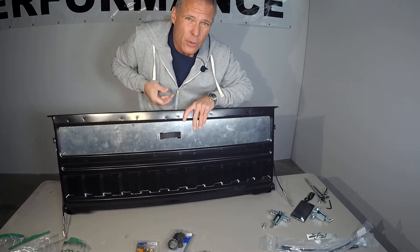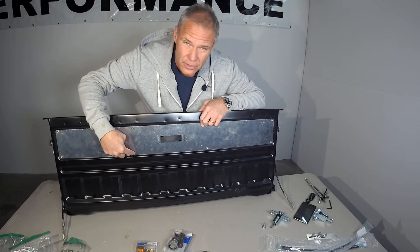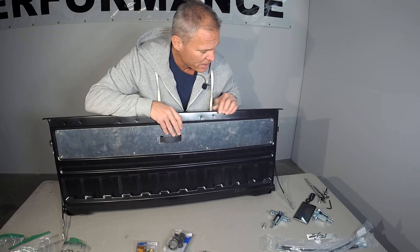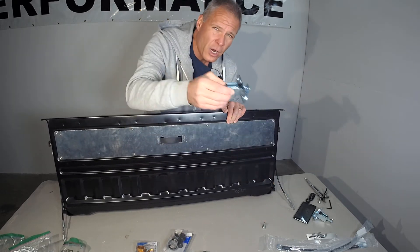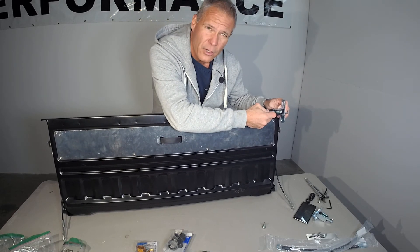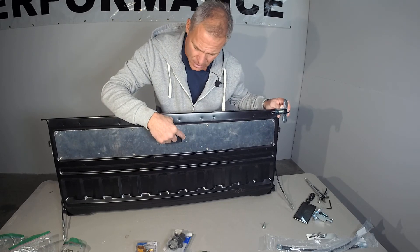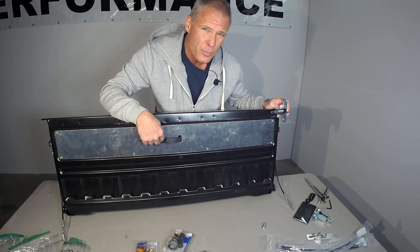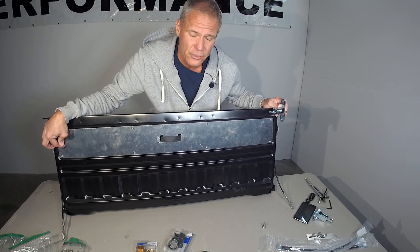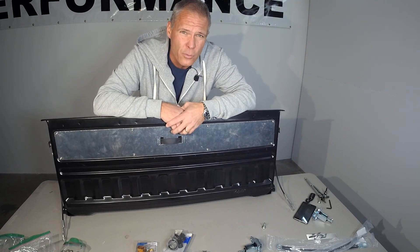This is just for the Audi kit. There's a trim plate with stainless screws that mounts to the tailgate on all the kits. This little strap is a hook and strap assembly. Here's your latch on the outside — there's a little spring hook that grabs the end. The strap goes all the way across, comes up through the rectangular cutout, goes back into the tailgate, and connects to the other spring latch. That is how you assemble the Smith tailgates taken from the Ford Ranger.